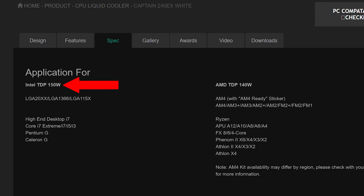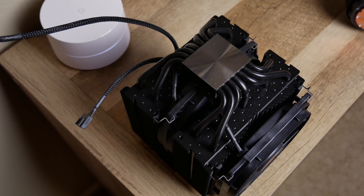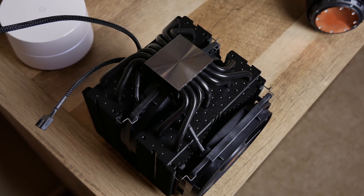But this TDP is significantly lower than the Dark Rock Pro 4's, despite having roughly the same fin density and weight. An AIO's performance is strongly linked to its fan speed. The DRP-4 utilizes seven heat pipes, but the 240EX has only a single tube of moving water. Thus, the fan speed can drastically alter TDP because water from only one tube is being pushed to the radiator where it's supposed to be dissipated by those fans. Several steps need to align perfectly for the system to function the way that it should.